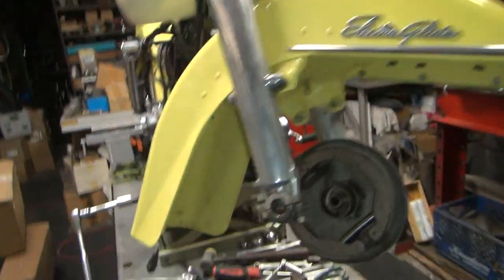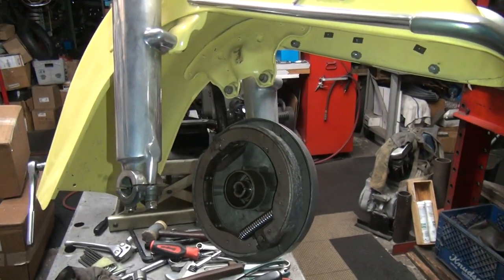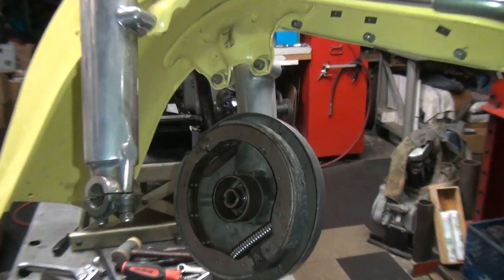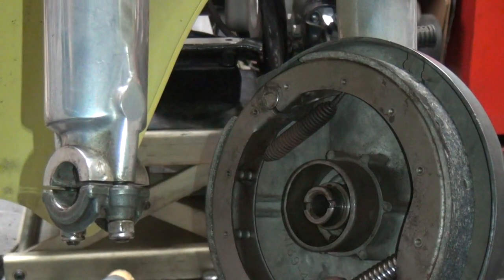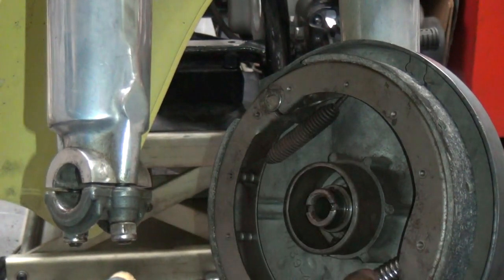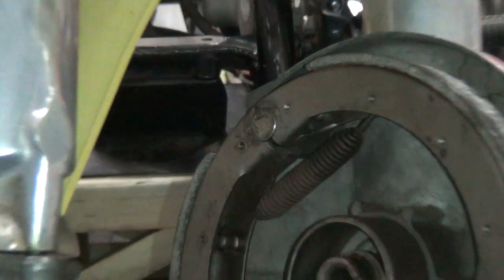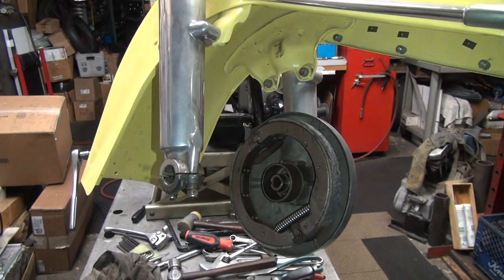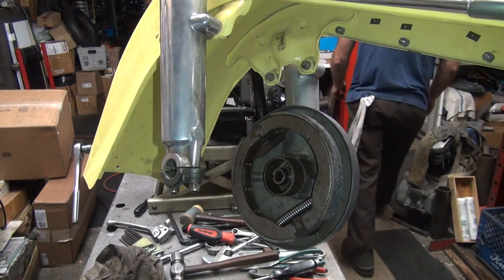So we're going to have to do something to highlight the mark area. So you can see in there that the shoes, or the springs up under here, there's no marks on here that I can see anywhere. They have different amounts of noise when they rub, see? So you can listen for it. Maybe you can tell a tune change. Some people can, I'm sure.